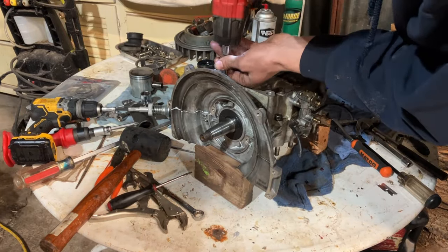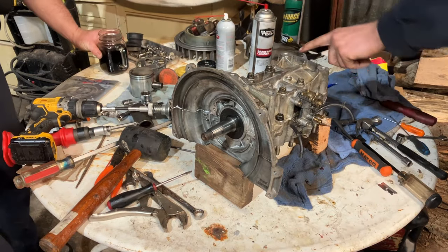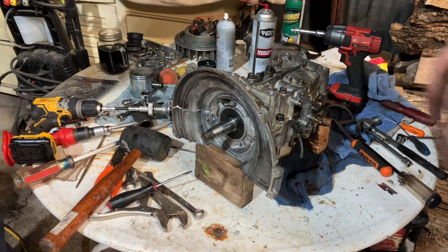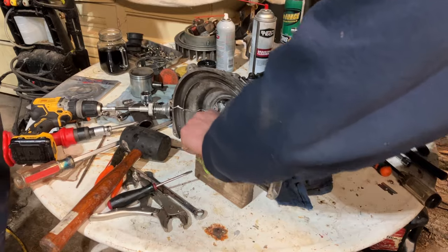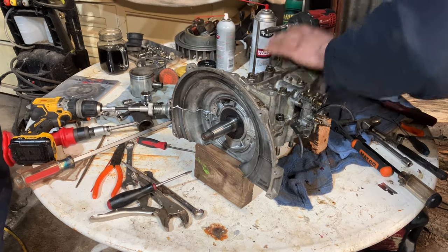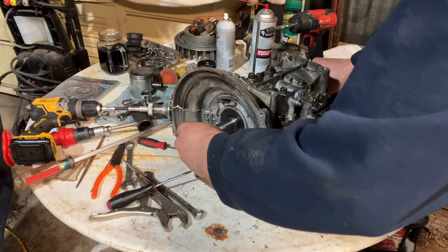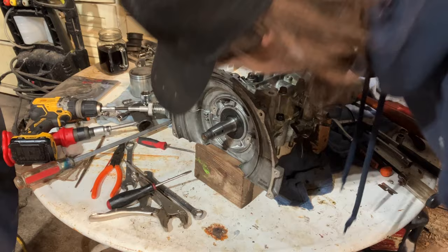And then I'll torque spec on all the little bolts. I would go 18 foot-pounds. The two end caps go 25, 26. And you'll be golden that way. And as you're tightening this, I'm going to be rotating it. Never hurts to give each end of the crank, before this is tight, a little mallet tap each way and wiggle it. That seats the bearings if there's a little bit of movement.